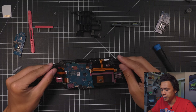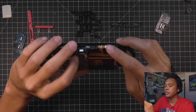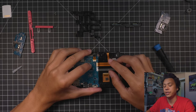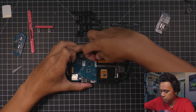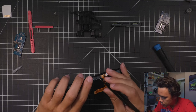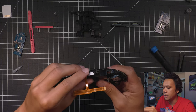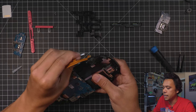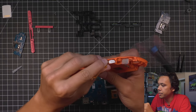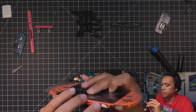The next thing we need to do is get this part off — this is the part that holds the power button and the power LEDs. Go ahead and unlatch that, peel it off very carefully, and then stick it to the new shell. It can be in there pretty good, so I like to start from the left side. Once you get that up, you can kind of peel it. Grab our new shell and transfer it straight over — you can't mess this up because there are little tabs that guide you right in where it needs to go.